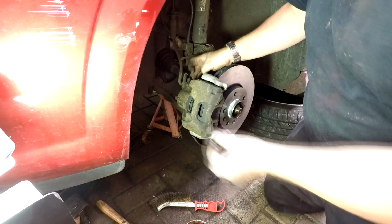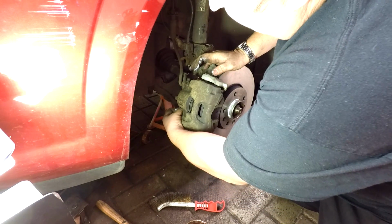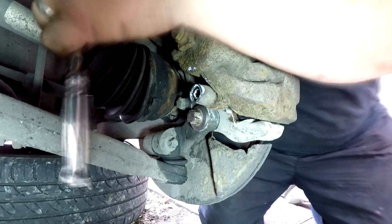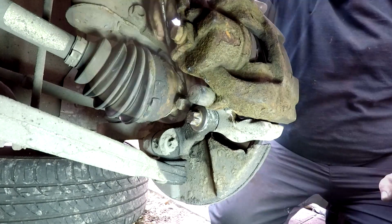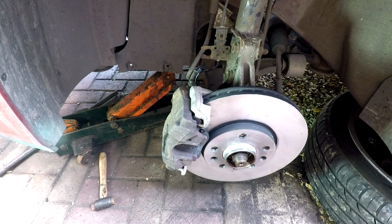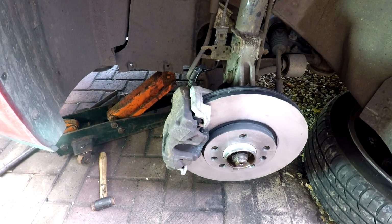Right, let's put these back in. They go in where them rubber boots are, if you remember rightly. And then put the rubber caps on, and then that's it. So I'm just going to put my foot on the brake, just to make sure everything's seated down correctly. Yep, pedals come right up. I'm happy with that. And you can't see me, but I'm around at the master cylinder now, and I'm just putting the cap back on there. Everything is okay there, so there's no problems whatsoever there.